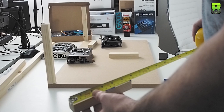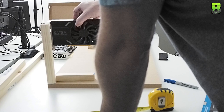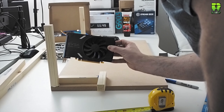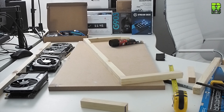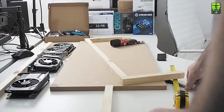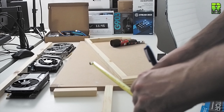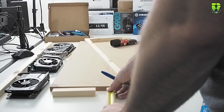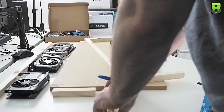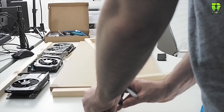Next, measure the mid support piece for the GPUs to sit on — mocking it up to understand what size to cut it to. It's a rough idea but the best way to figure it out. Then glue the 760mm main support bar against the two rear struts so you end up with a football goal shape. For the front leg supports I ended up at 130mm and the mid support at 160mm, but this will depend on what GPUs you're using — you can make them slightly longer or shorter. Mock it up against your GPU and ensure there's enough clearance once the GPUs are in place. Then create those L-shapes and glue them together.